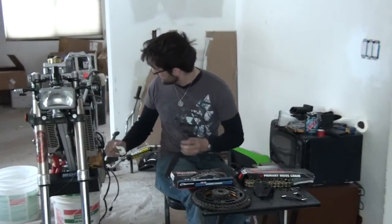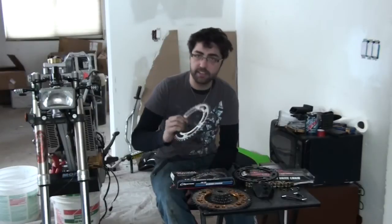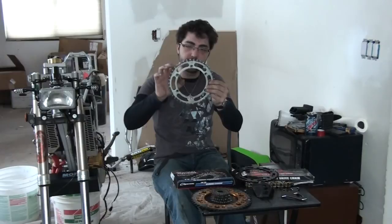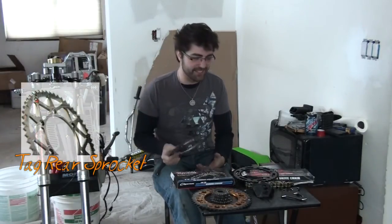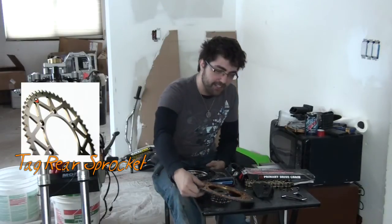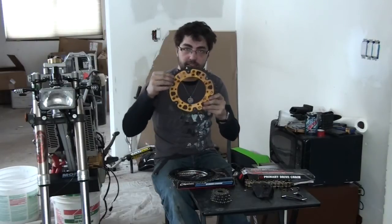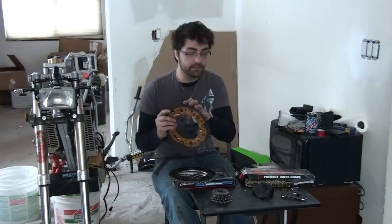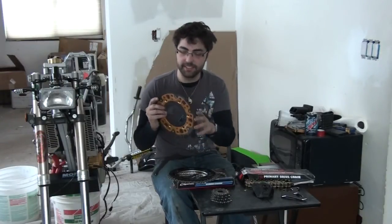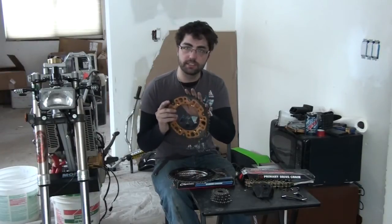There isn't really much complexity up until about 45 teeth on the sprockets, just because there isn't a lot of material between the teeth and where it mounts to the hub. But once you get to about 45, you start getting lightweight composite ones like the Super Sprox — the gold part is made of aluminum and it's riveted to a steel outer ring. Since aluminum is softer than steel, when it rubs against the steel chain it will invariably grind down the gear teeth faster. When you have same metal on same metal, it grinds down slower and takes longer to wear out.